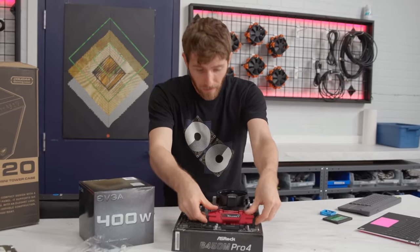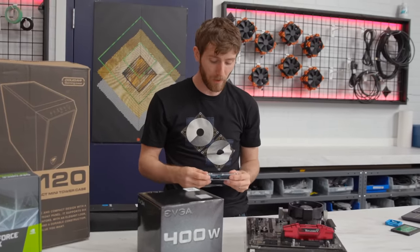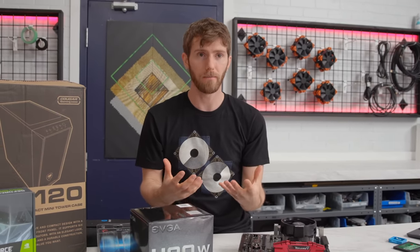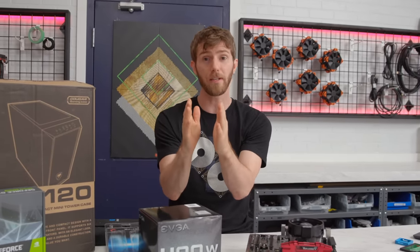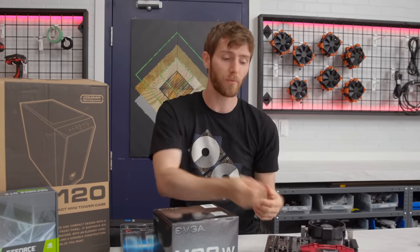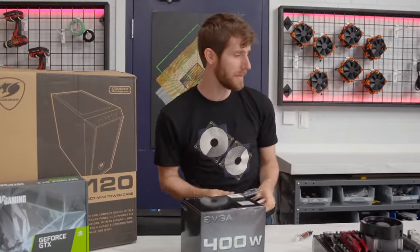It's all about not leaving performance on the table unless you absolutely have to. It wasn't that long ago we'd tell people to get a single stick of RAM to give themselves more upgrade room. If you have enough money for eight gigs, instead of buying two 4 GB sticks and limiting yourself to 16 GB total, you could buy a single 8 GB stick and then add another later, giving you up to 32 GB before you have to flip old sticks on Craigslist.